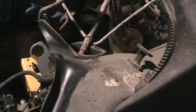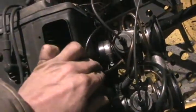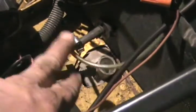First thing you might want to do is get your primer working. The system usually dries up, and when you pull that knob in and out, it's not sucking any fuel. The primer just goes to a pipe and squirts a little gas in behind the carburetors to the engine. The way I like to do it is just take off the gas cap, put my mouth on the gas tank opening, make sure there's gas in there, blow in there as hard as I can while sealing around my lips, and then pump this thing up and down until I can see the fuel coming out. If it still doesn't work after that, you've got to make sure that every connection has a hundred percent seal, because if it can suck the tiniest bit of air from any point, it ain't going to suck fuel when you start pulling that knob.